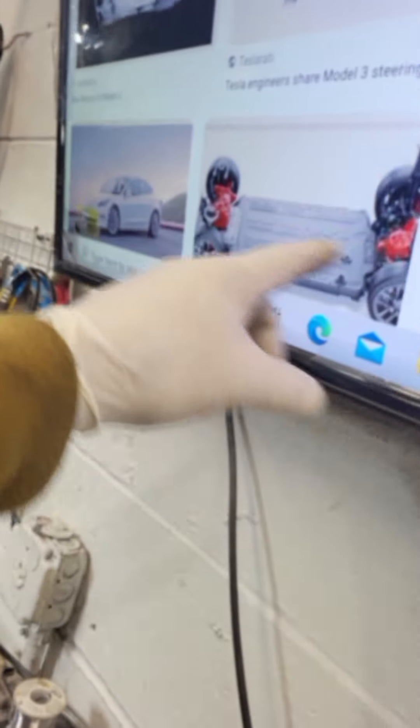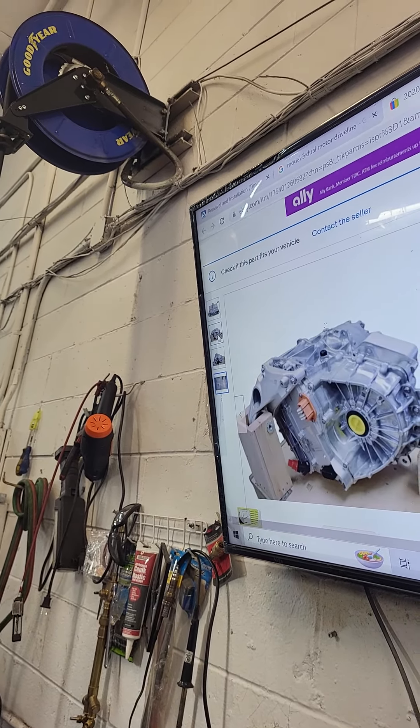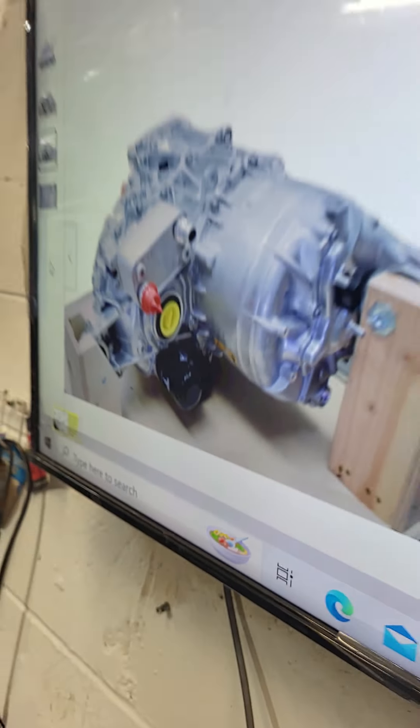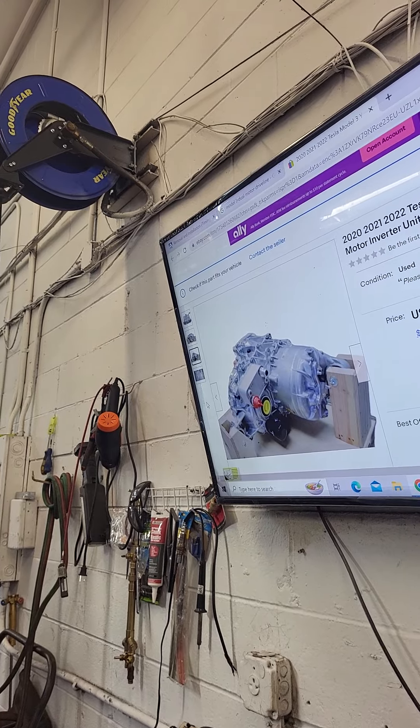Your front diff has its own motor assembly because there's no room for a driveline connecting everything — and that's your battery between them. There's no recommended service listed for antifreeze and transmission fluid, but that's a lie. Transmission fluid needs to be maintained, gear oil needs to be maintained, coolant needs to be maintained. See the external cooler on it? External coolers fail on most cars. And there's your filter. I wonder what they charge for a front diff service — probably $800, something completely obnoxious. Interesting — alright, thanks for watching.